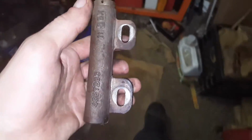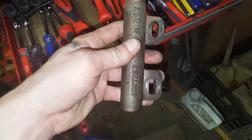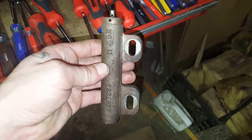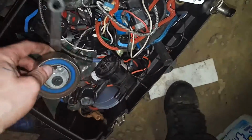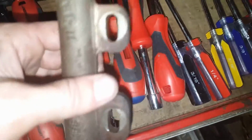And we're back. So he got the tensioner pulley on there. Here's the actual tensioner. First gen 2.0s, single cam and dual cam, come with this kind of tensioner. The 2.4 is a mechanical tensioner, and there's actually a couple different kinds. Here's one kind like this, but normally they have an Allen key that goes in there and you spin it around.